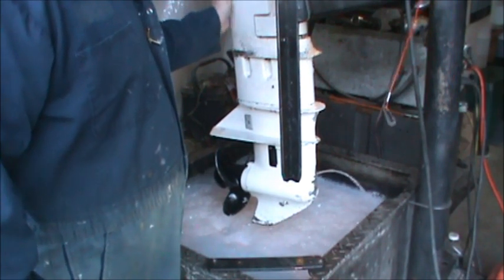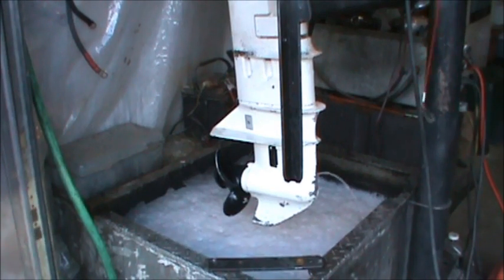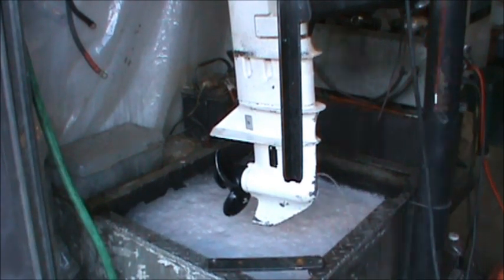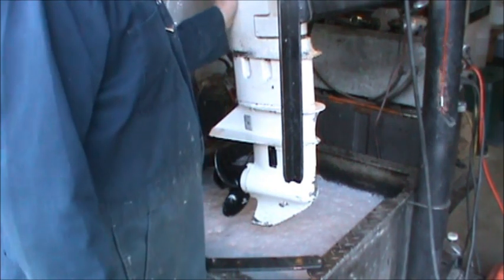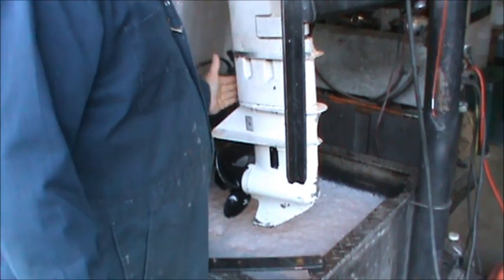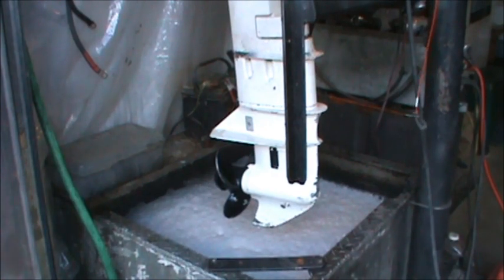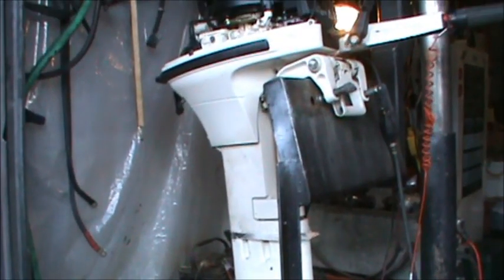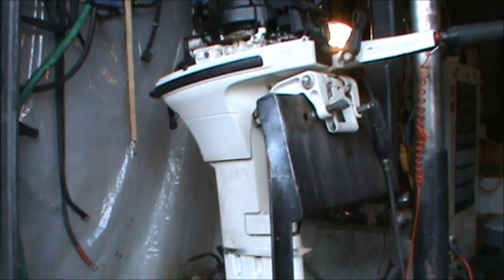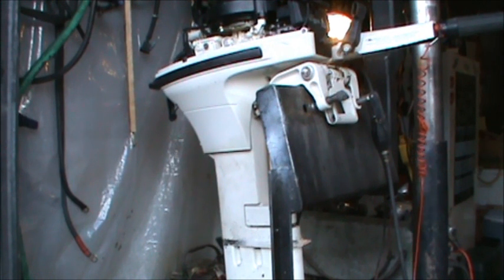He's got grommet problems in there. There's no way that should be that hot in that leg. So the only thing I'll drop the water pump. You see how strong it's peeing. So I'll drop the water pump, but I believe the power head's gonna have to come off on this one. I believe he's got grommet issues up under the power head. It ain't flowing completely up through there, around and down like it should. I'll be right back.